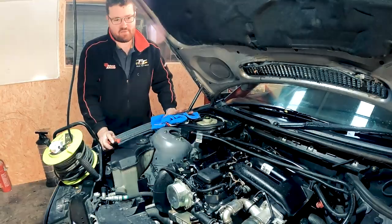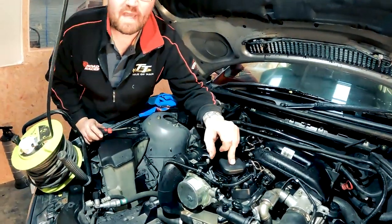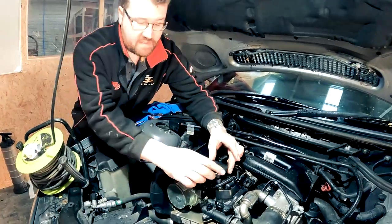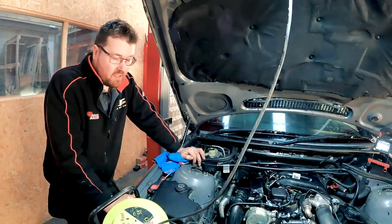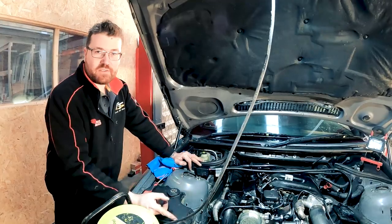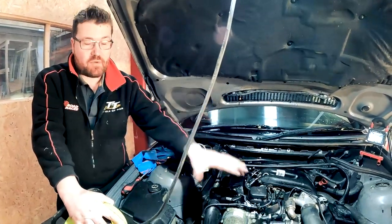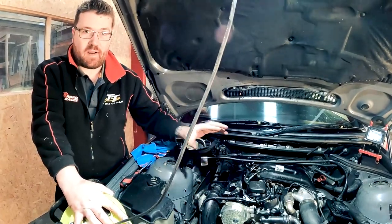This has me baffled, but I think I have it fixed. As I showed you earlier, we pushed the tabs down on the oil cap, which has given it a better seal - there was a bit of play in it and now it seems fairly tight. So I'm not going to drive it for a while. There are a couple of bits that still need to be done. I did notice the thermostat wasn't opening correctly, which means the engine is not getting up to the correct temperature. So in the next video, we're going to remove the thermostat housing, put in a new thermostat, put all this back together, and bring it for a spin.